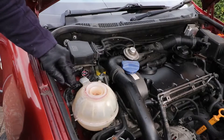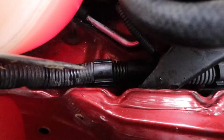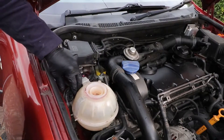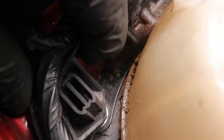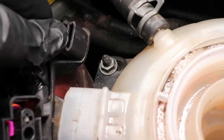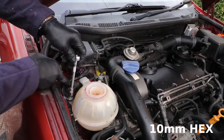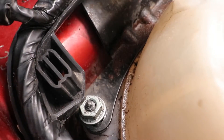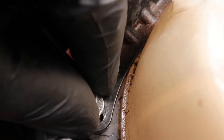You need to take this plastic cable guide that's attached over the top of the nuts that hold the tank in place. First remove the clip on the cable trunking on the inner wing — just here — that just pulls out. Take the cable guide off: put your finger around it, lift it up gently but firmly, then pull it back slightly to expose the nuts. Then take off the nuts — I use a quarter inch 10mm socket and wrench — loosening them until I can get hold of them with my fingers. Be careful not to lose the nuts into the engine bay.